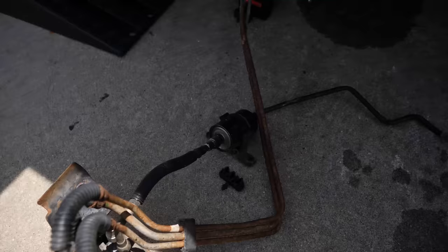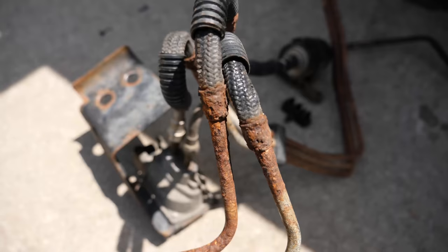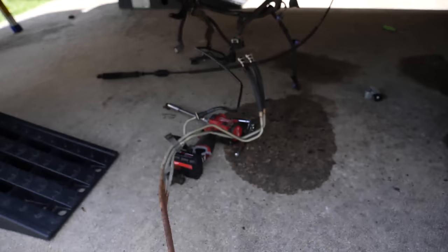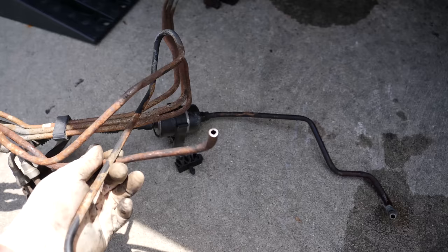This part is pretty crusty, but this was really what I was seeing — I was more concerned with this section. You can see how pitted that is where these are crimped on, which could be a huge problem — a real failure point. We've got rubber on one end, rubber on the other end, and then just this little section of steel line that connects the pump to the rail. Let me show you what I did to get that return fitting off, because this thing was a pain in the ass — it just wouldn't release.